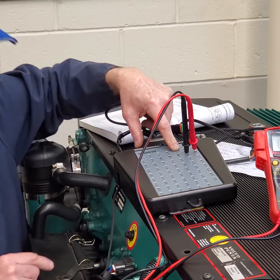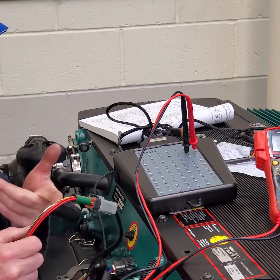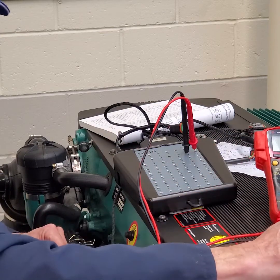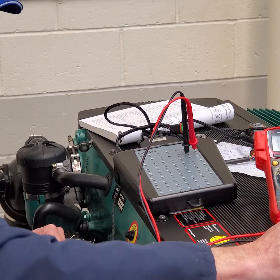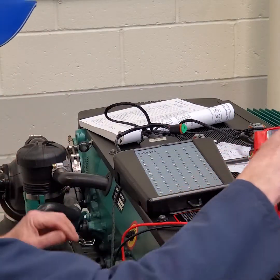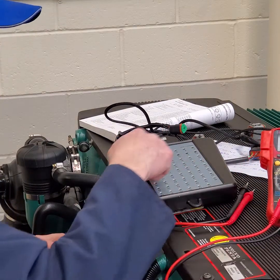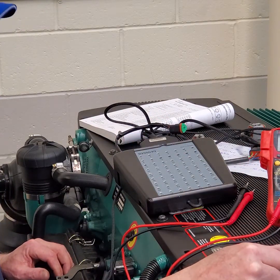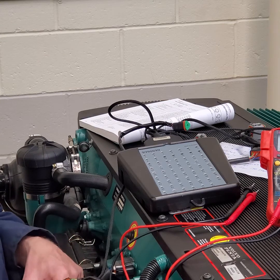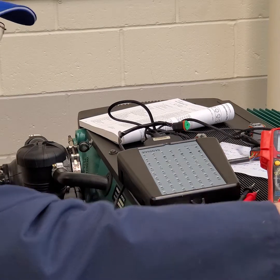If the harness is not the problem and you've used your extension harness on a known-good engine and confirmed the tool works, then what's left? The PCU. So your communication driver in the PCU is bad — that's how you test to confirm that problem. DC voltage is another option: if you don't have frequency, you should still have some voltage on those two wires. This is how you diagnose a diagnostic tool that does not function, possibly due to a failed driver in the PCU or a harness issue.